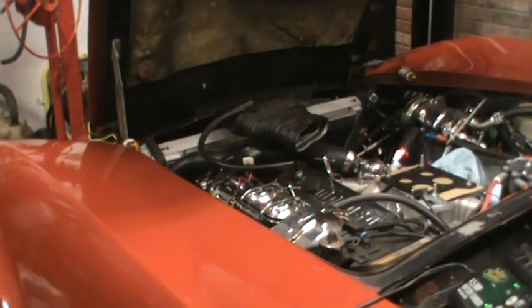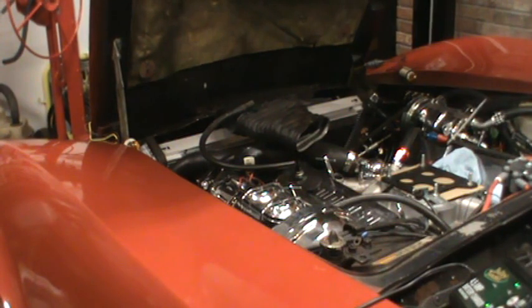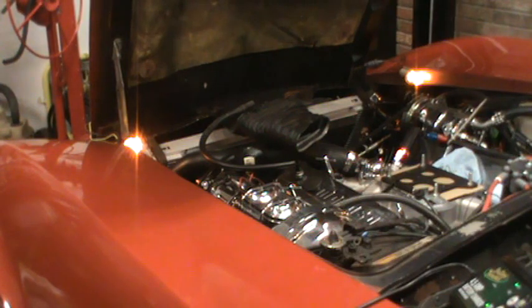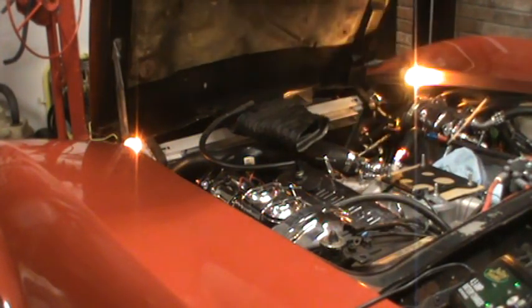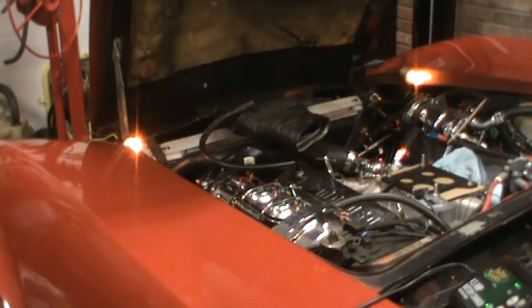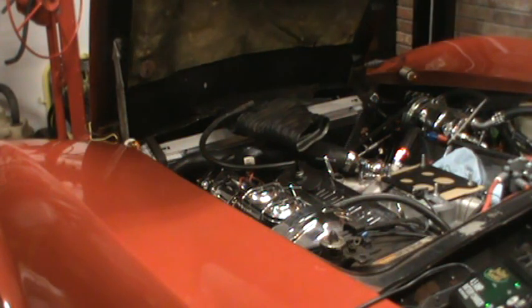Okay, I may have had that bulb in there wrong, because I rotated it 180 degrees and it actually went in easy. That looks better. Yep, that was the problem. I didn't have the bulb in right. Those bulbs have one of the pins higher, and if you force them hard enough, you can get them in the wrong way around. So that is obviously what I did. Okay, so that is a done deal.